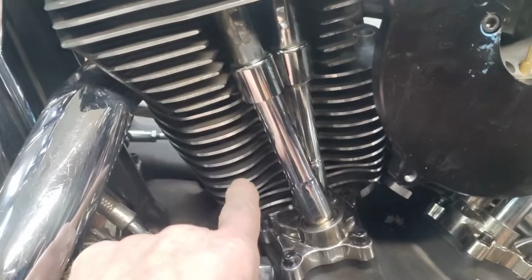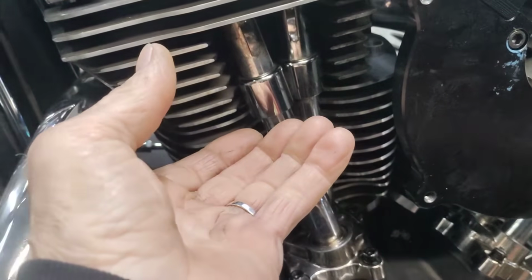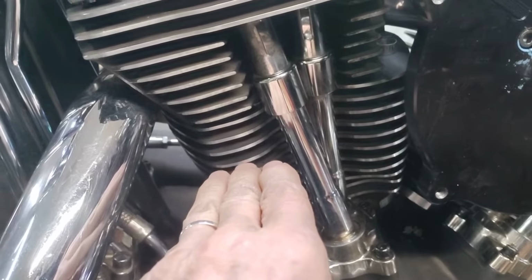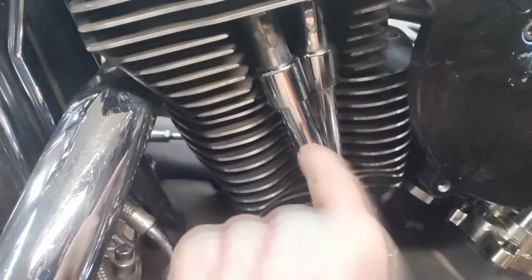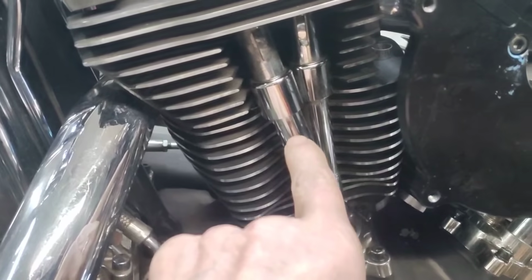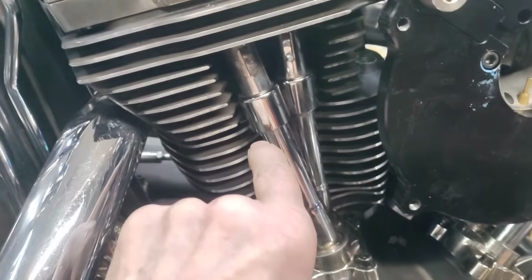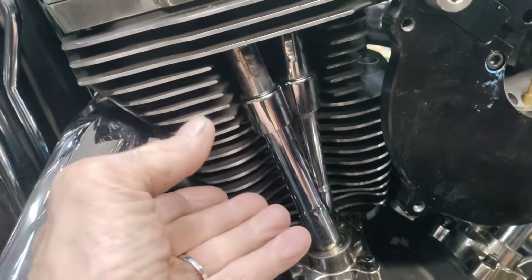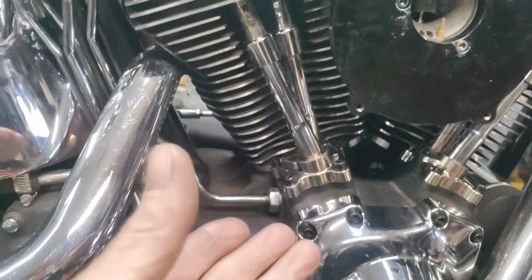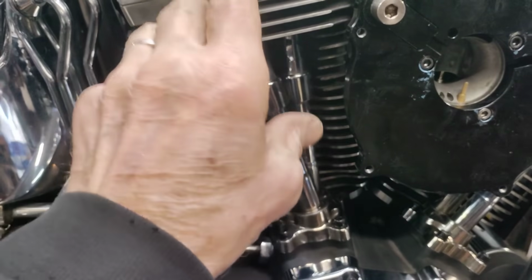So we pushed up the piston so it disappeared in the jug, set it over, then pulled it back out without pulling the ring, getting it close to that oil ring. And then that way we put the piston wrist pin through the piston rod and through the two spots it goes through in the piston, and then pushed it down. So I thought it might be better than trying to push the piston up into the jug when it's here.